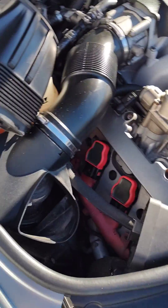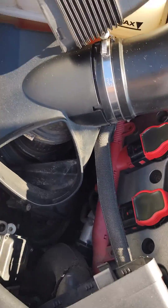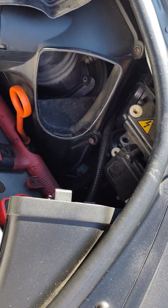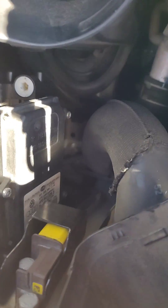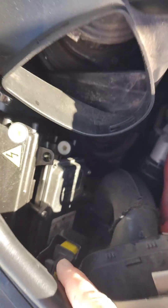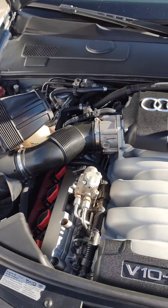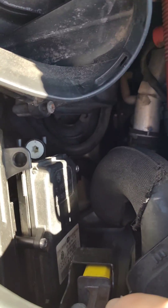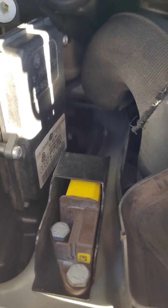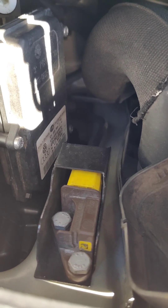What I've done is I've disconnected my battery and removed both of these. This is the one that's reporting faulty right here, and this is the identical sensor on the opposite side. What we're gonna do is swap those around. There are two bolts right there, and then you can take it out and disconnect the connector.